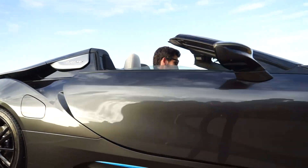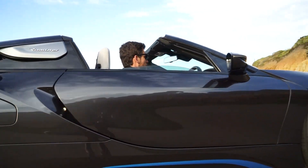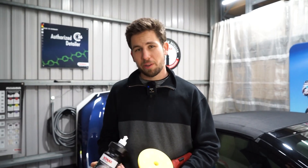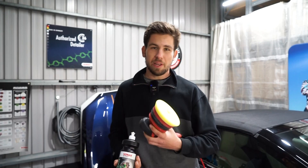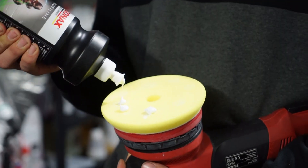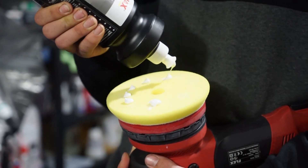To see how we got this car looking so good — and you can do the exact same — follow me. So we've just travelled back in time and I'm going to run you guys through how we got to that end result. We didn't have to do much polishing on this car, so that's why we're going to use a finishing compound with a medium pad. My favourite combination is Perfect Finish with this yellow pad here. We just put a bit of extra polish on to prime the pad, and now we can get started.